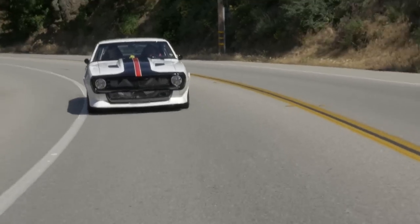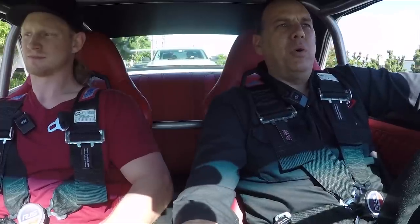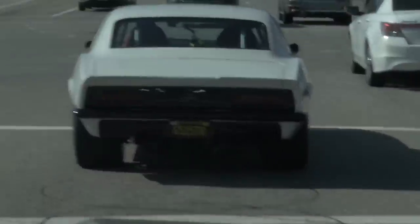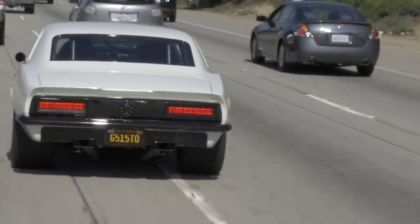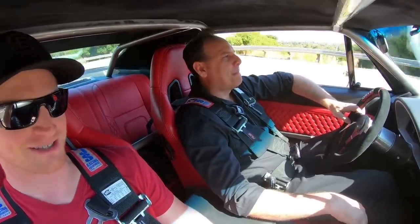It's really important to find a good builder, somebody that's vetted and trusted. So this motor is a 388 — it's a daily driver, super mellow. I mean, 18 inches of manifold vacuum, so it's something you just drive wherever you want to go; lasts a super long time. It's got straight pipes — just turbos, no mufflers, straight out the back. I've been debating whether to put some straight-through mufflers on it, but I kind of like it. It's pretty mellow at idle — out of boost it's pretty tame, like a grocery getter. Every time I start it up at a show people are like, 'that's not it' — then they see the hood open and they're expecting it to be a top fuel drag car.